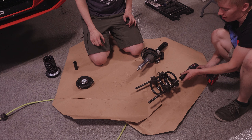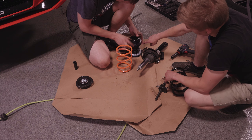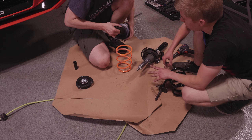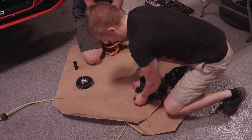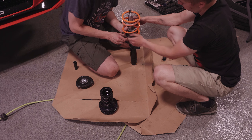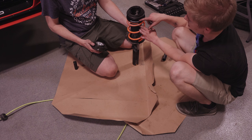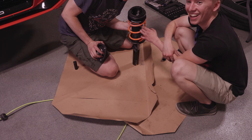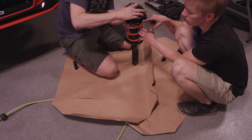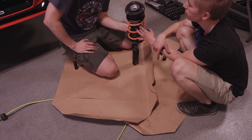I'm really glad we spent four hours figuring out the left side first — this is going way smoother. Some of the assembly really tricked us out. Basically the thicker chunk goes towards the top and rests on the metal piece. Once you get the dust guard through there, you'll be able to press fit that on. The skinny part goes down and rests into the little rubber bit. We adjusted these so they're both the same. We know this will adjust from 10 to 30 millimeters lower than stock, so we're shooting for a happy medium.